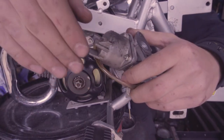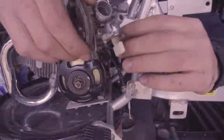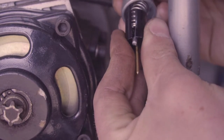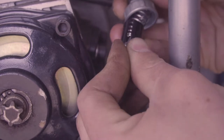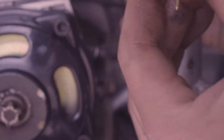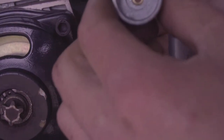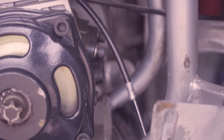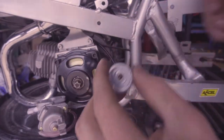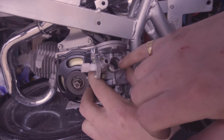The best thing to do is just replace the carburetor. To remove the old needle, squeeze down on the spring, get it off the channel, pull it off — and that's it, the needle is free. You can throw that out because your new carburetor is going to come with a new one. The spring and the last cap also come out — discard all of it. Your new carb comes ready to go. Open up the top cap and don't lose that spring when it pops out.